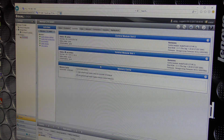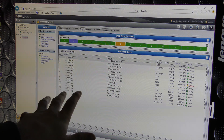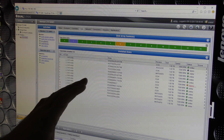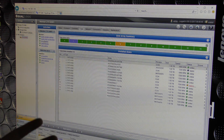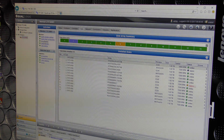The controller says it's all good in here, so it's probably just the battery. All of this is set up in RAID 6 - I believe there are two hot spares. There are 14 drives so there's like 10 drives of usable storage, and all of these drives are two terabytes. That's all good, but it's not performing as well as it should.